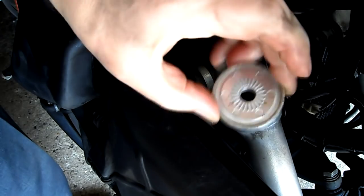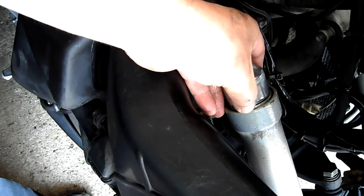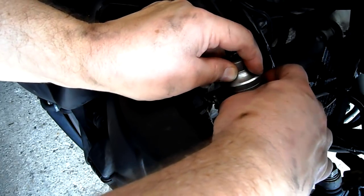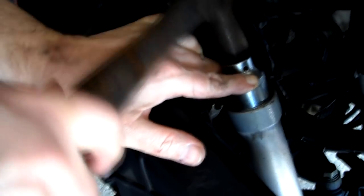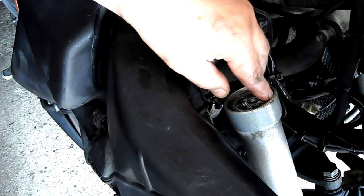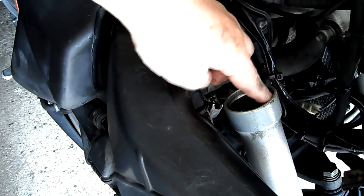Once you've pushed the seal in with your fingers, you now need to force it down to its proper position. There are two ways of doing this — the proper way and the way I'm doing it. I've got an oversized washer which is just about the right size with a socket on top, and if you're very careful and centre the socket over the washer, you should be able to push it down with a hammer. The proper way is to get the proper BMW tool and the various adapters that come with it. Be careful if doing it the DIY way — you want the seal to go down squarely; don't be tempted to knock it in off-centre because you'll damage the seal. The BMW tool costs an arm and a leg and quite often BMW dealers won't even sell you the tools, so it's up to you how you do it, but make sure you don't damage the seal.